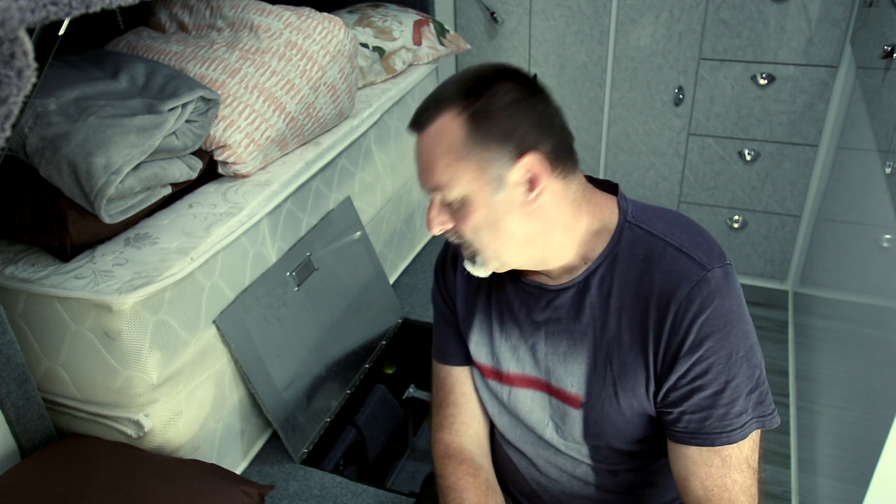Turbo mode hasn't managed to go over that 100 amps — maybe the motor was already at maximum, or maybe the van has cooled down enough that it can't do more. I've turned it back down. I was starting to see a small dip in battery voltage to about 12.9 volts, which is still fine, but I've probably been running it for about an hour now. The inverter is a great little unit — barely broken a sweat. Back down to 50 amps now on fan speed 1.